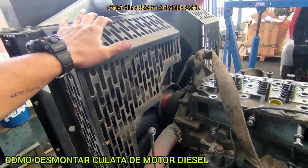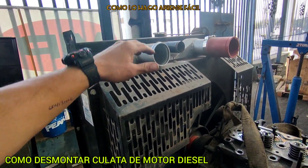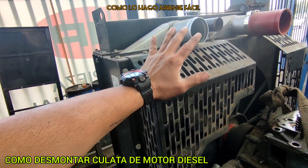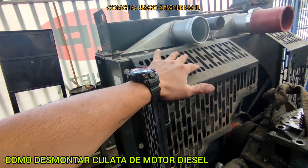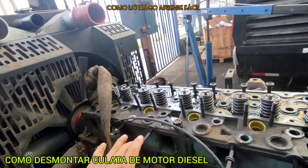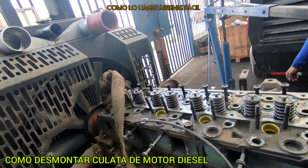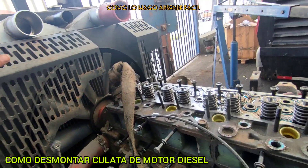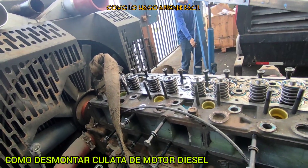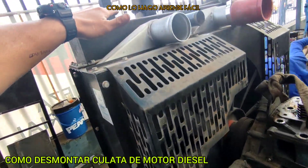What happens is that during operation, the water began to boil in the radiator. As we have seen in previous failures like this one, it is because the gasket has blown and part of the compression from the combustion chamber — from the piston — is leaking into the water cooling zone. The air inside the chamber has more pressure, so it blows all that pressure into the radiator.